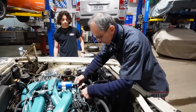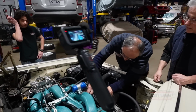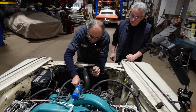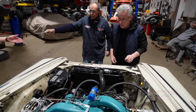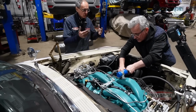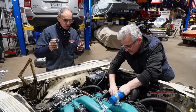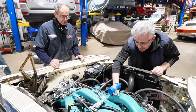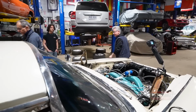This is a wild guess, I don't need a timing light. Let me see my marks. There, right there. Now I've got it marked without the vacuum advance. Okay. There you go, Nico. I think, you know why? Because when you accelerate, the vacuum goes to zero. That's right. It backs up the timing. And of course, so highway gear, no high stall torque converter, you're not gonna get an acceleration. Let's see if I'm right. Let's give it a shot. Ready? One way to find out. Let's go.